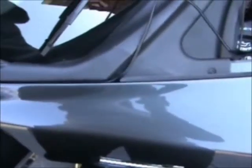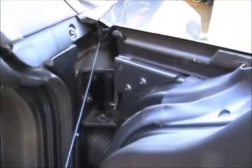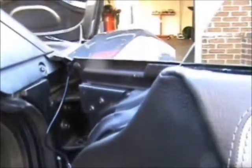I'm going to need both hands so I'll set the camera down. You can see how it's pulling through right to the side here. I'll pull all the slack, tuck it in nice and neat, then run it down and bring it in underneath this weather stripping, down around the body, and into the passenger compartment where we'll be drawing power from right under the passenger side fuse panel. I'll show you that shortly.